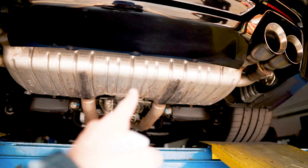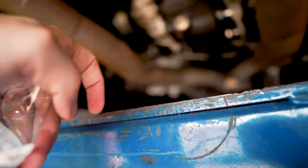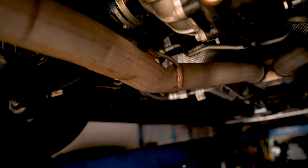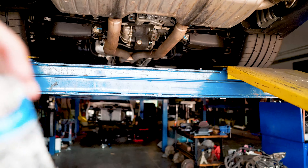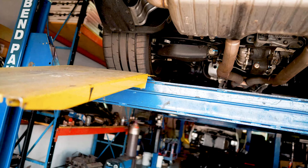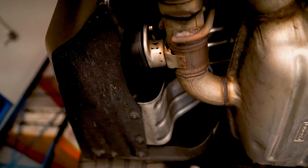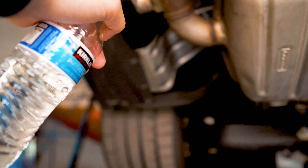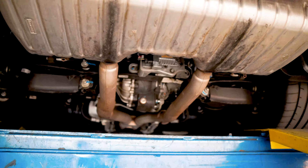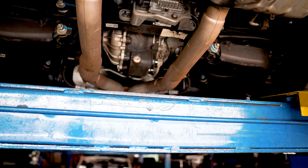So this is what's going to come off later, and possibly these because there's a dip right over here from factory — right there, if you guys can see it. If you do the double X pipe with the Corsa setup it's three-inch pipes all the way back, and then you have the variable exhaust where you get to keep that right here with the Corsa setup, so that way you can open and close the valves, which is really nice. This is what you want to keep. I can't wait — it sounds great on the car, I love it absolutely, but I can't wait to hear what the Corsa sounds like.